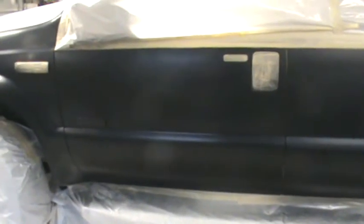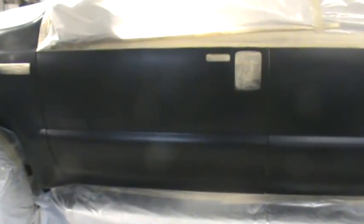For cleaning your gun, it'll be okay, but you don't want to use a polyester reducer and a urethane base, or vice versa. Now you can put urethane reducer in polyester base if you're going to clear it with urethane clear. But you're getting into the chemistry thing there.